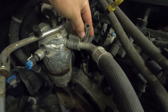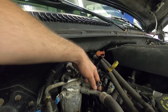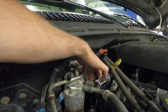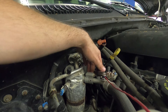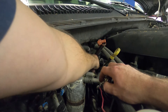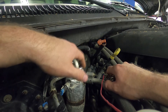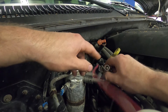So I disconnected the spark plug wire — and this gets harder to do on newer cars, but on this 02 it's fairly easy because it's got what they call a coil-near-plug, which has short wires that run from the coil. I plugged in my spark plug tester and ran a jumper ground wire from here over to the alternator bracket. I started the truck up and this thing was jumping like crazy, so I had good spark coming out of this cylinder. Then I put it back together, disconnected the coil real quick, and it changed nothing — the coil wasn't contributing, and it ran exactly the same as before. That confirmed that cylinder number eight was dead but does have spark.